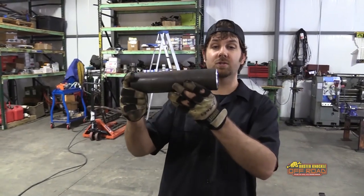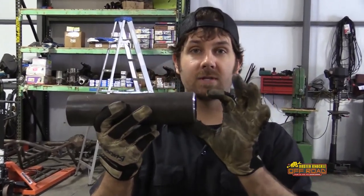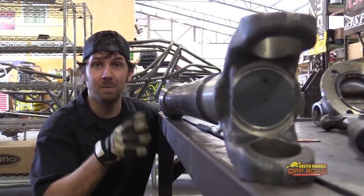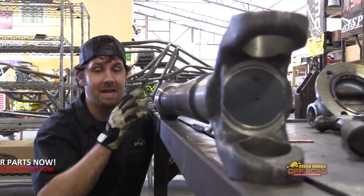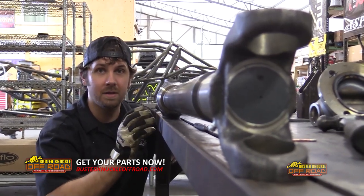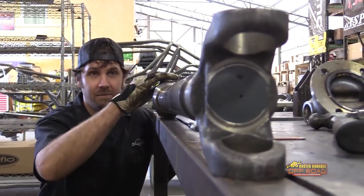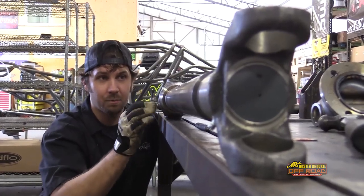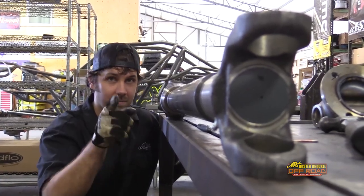Make sure you bevel the back edge so that when you're doing a weld you get a lot more surface area, giving you less chance of that thing breaking. Also, you have to be very careful that the yokes are absolutely flat with each other — that's called phasing the yokes. If you don't have the yokes phased properly, it's going to vibrate. We're using a flat piece of bar to put both yokes on, press it down straight in the press, and check it again. Make sure your yokes are phased.